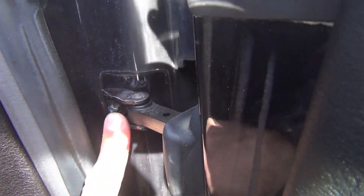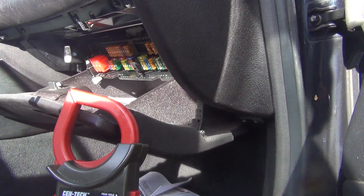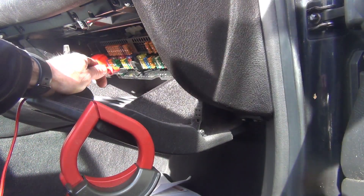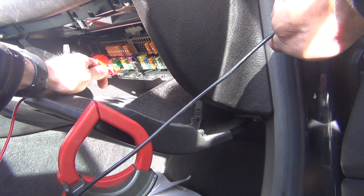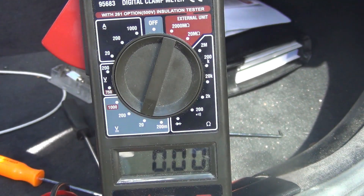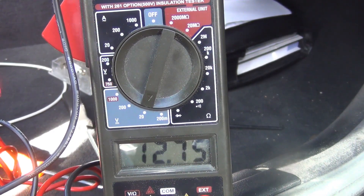When you're looking for a ground, usually you can use the bolt on the door brake — that's usually a good spot. So checking for power, I would just pick a fuse. I'm going to go to this 20 amp one here and go to the door brake right here, and then on my meter I should see 12 volts. I'm going to do that where you can see the actual meter — I'm going to one side of the fuse and then to my door brake right there.